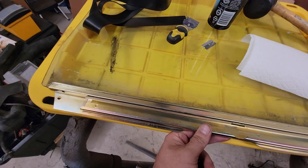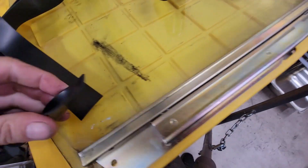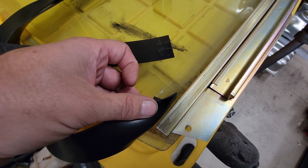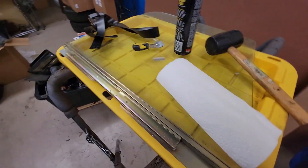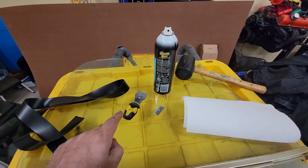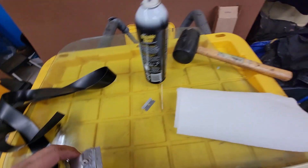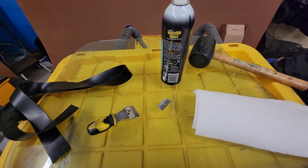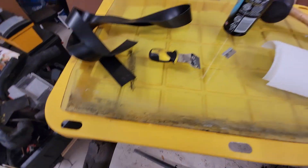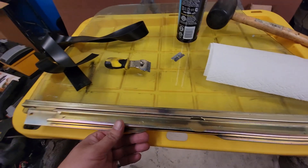Then I'll clean off all the other garbage, get it nice and clean. We've got this rubber gasket that folds — fold it up, stick it in there. I'll use window cleaner to lube it. I'm going to use a glass cleaner to clean the window, then use a razor blade to scrape all the paint overspray and years of smudges off. I might even grab some steel wool, give it a good shining, then clean off all the garbage so the sash has a nice clean surface to sit on. Light tappy-tap and she'll be seated and ready to go back in.